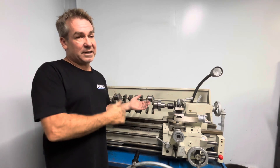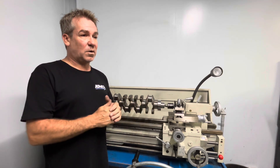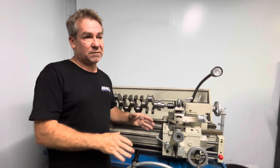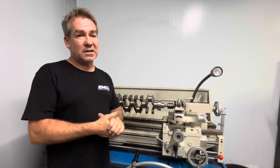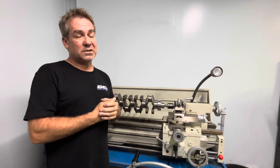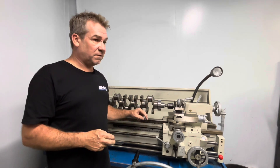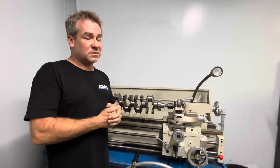That's why it is worth spending the time doing it correctly, making sure your sealed surface areas are perfect — that way you're not going to have problems. It's incredibly important. Any crankshaft-style failure is devastating — it's massive. If the crankshaft fails, it's engine out. It's not like you just had to put a litre of oil in it at 10,000 Ks — this is over. You're sitting on the edge of the road with a loud knock. Make sure whoever you bought the engine off did this right. Don't just go to someone that has jammed a set of standard pistons in — you'll pay virtually the same amount of money and get a lot less quality job.